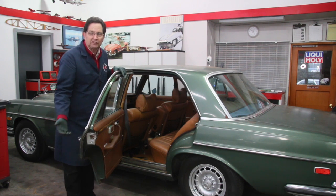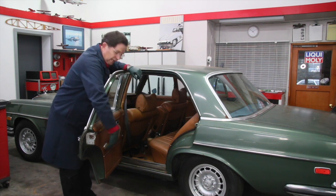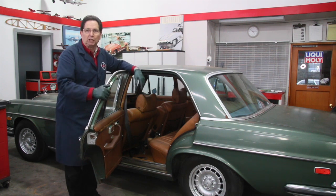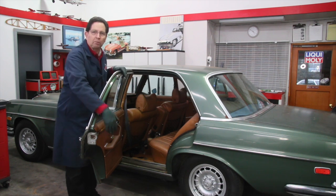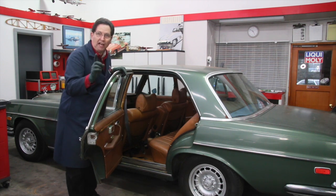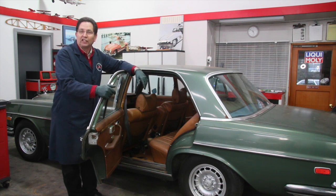You can't do it from the outside. You need to clean the bottom of the door. If there's any rust along that bottom edge where the water drain holes are, you need to coat that with Miracle Paint. You need to do all those things when you first get one of these cars. 'Cause I've seen people just ignore the problems. Pretty soon your regulators don't work, your doors don't open, but worse yet, you get rust out along that bottom part of the door if you ignore it.